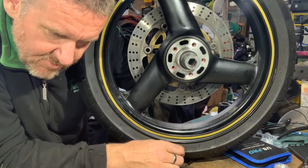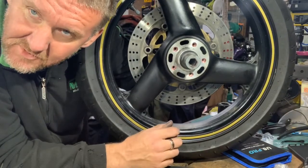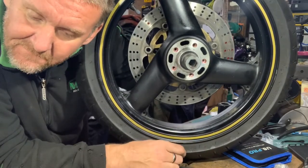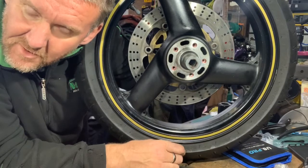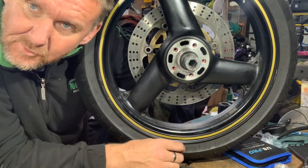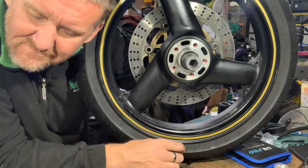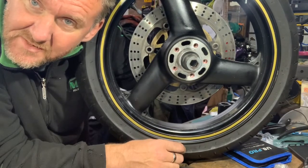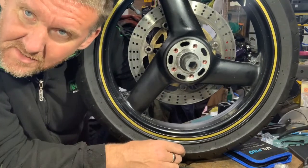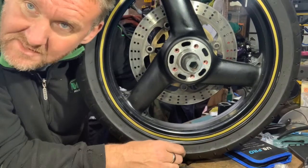And I've also got a new fuel tap seal to put on and a fuel tap to put back on. I've just been putting those carburetors back on a little bit earlier, and I've been putting a different fuel line on rather than what was there. It was like a fibre braided rubber fuel line, but the rubber fuel line itself is not particularly thick, and it does split quite easily, especially if it goes around bends. There were a couple of bends, so I replaced it with slightly thicker, same diameter but thicker fuel line. So hopefully that will last a bit longer.